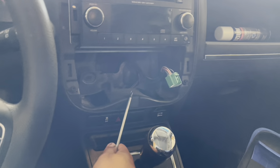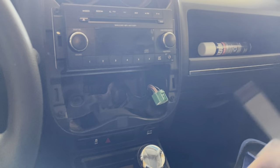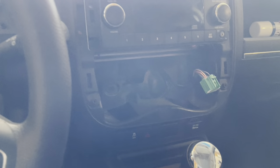So I guess I am going to show you guys. To remove this, you just wedge right here in the middle — one of these pry tools, actually came with new ones in the kit. Wedge it in there, just pull it out. That's it, literally. Then you got these screws right here to take off the radio and it all comes apart.